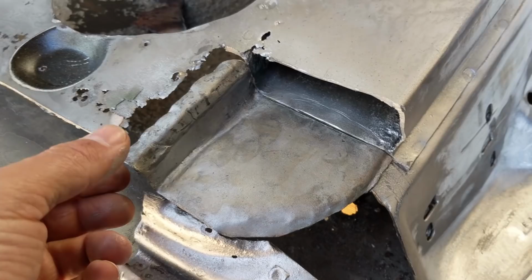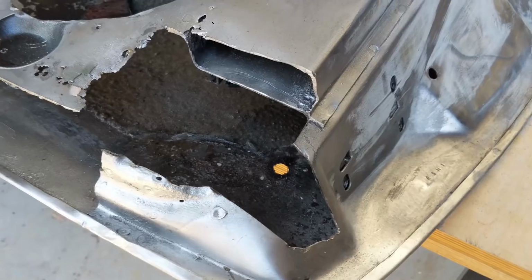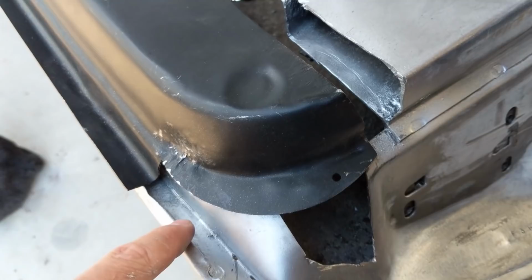Basically that bracket underneath there, as you know, was really rotten. And it came down to there as well, so I decided to take that section out and split it up into two. Unfortunately, the panel, as you can see, comes short there. So there's a little lip that goes underneath this, so I folded all this back. You can see it's all folded along there, and this metal's good, so I'm going to leave it. I don't have to replace that skin.